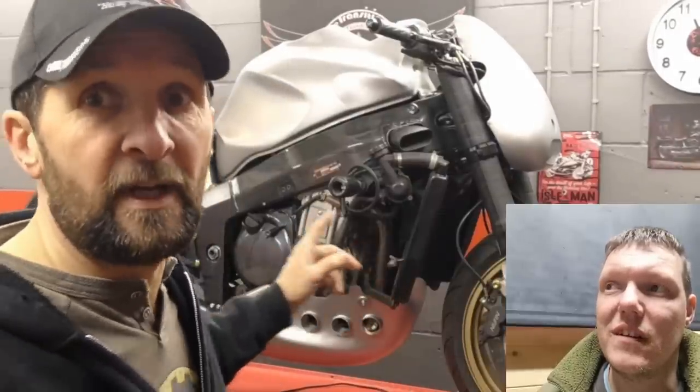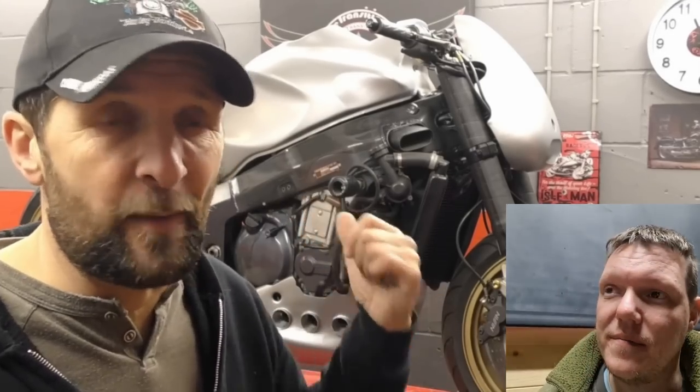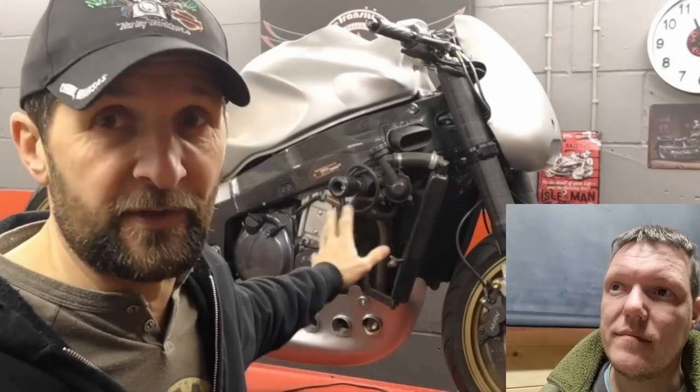Your oil basically has additives in it to deal with this. And then when you warm your oil up, it evaporates out. That rids the water content out of your oil. Again, it needs to be 45 minutes. Otherwise, it will just stay there, and it will end up with an oily emulsion. When this goes on the road next year, it will get a full oil change and filter and everything else long before it does. So that oil that's in there is not important. It's actually only done 1,000 miles, so it's perfectly fine for storage purposes.